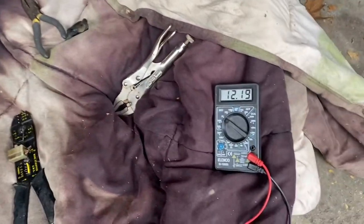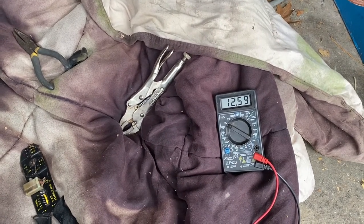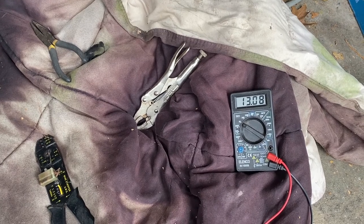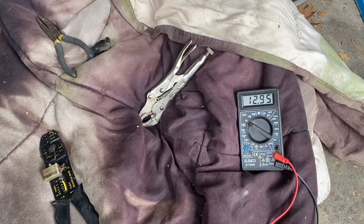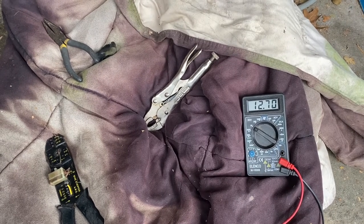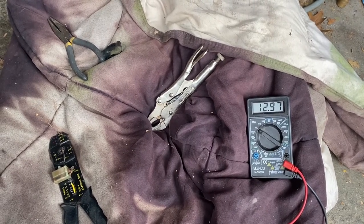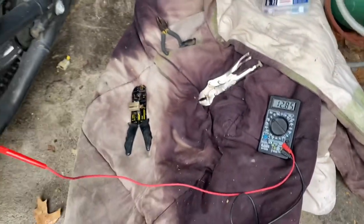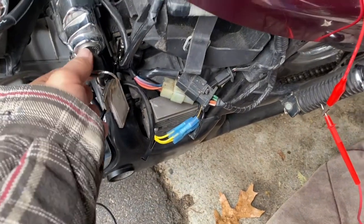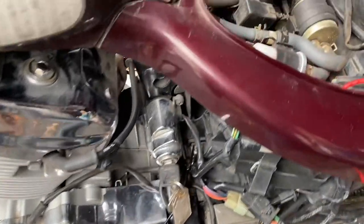She's just weak. The battery is charging right now — that's where the battery voltage lies. Let's see with a little bit of revving — she's picking up, so that's a good sign. We're up in the 13s — that's a real good sign. She doesn't like to rev a whole lot, but again that's the carb issue. Looks like the charging system is working! Now she shut off — she's probably overheating a little bit. I didn't hear the fan kick on.